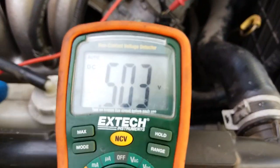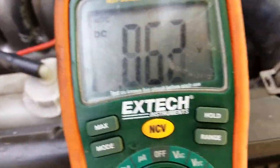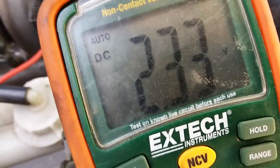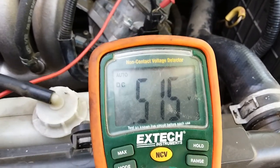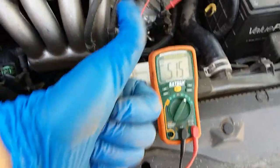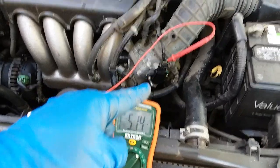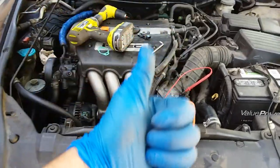Now what we're going to do is open up the throttle. I can't open it all the way, but about halfway it's reading at 2, and it should read all the way up to 4, so it's working. It set itself back to 0.51 — anyways, it's at 0.5 voltage, so that's where you want it. And that's how you change a throttle positioning sensor on a 2004 Honda Accord Inline 4. Thank you for watching, please like and subscribe.